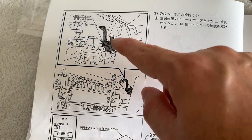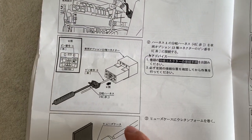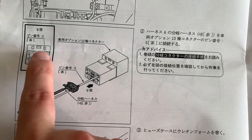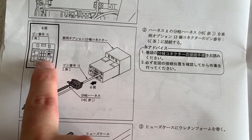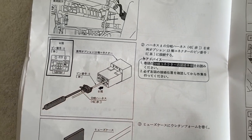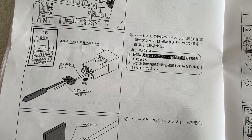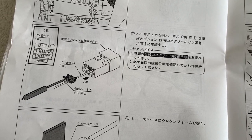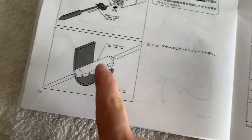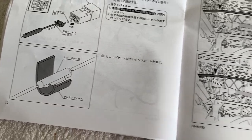There's another diagram explaining the bend and angles, and where and how you install it. It's a 13 pin connector — this one has nine pins with four large ones, so the top right one should be the red wire. I don't know if it's always on or ignition triggered — I assume it's always on because when you open the doors you don't have ignition enabled. The fuse is actually an AC rated fuse, not a correctly spec DC fuse — but anyway.